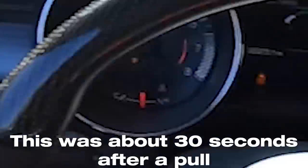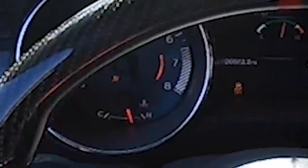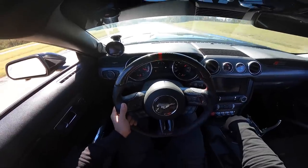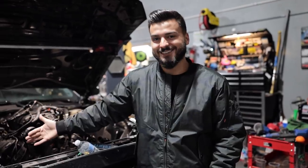Definitely spinning our asses off, but it was holding. We were going straight — that's all that matters. Let's give her one more go. Directly after that we went to do another pull, and that's when the radiator hose blew off. It makes sense now looking back in retrospect — the head gasket blew, it was over-pressurizing the system, allowing boost to get introduced into the cooling system, and obviously blew the hose off. But at the time, temps were fine when all of this happened, so I had no clue what was going on initially — I just thought the hose popped off.